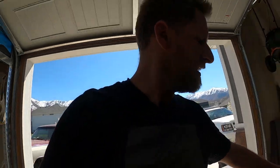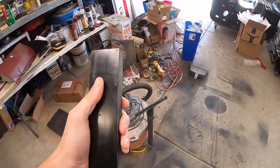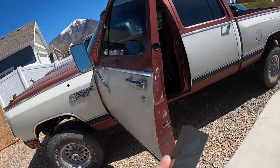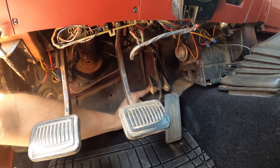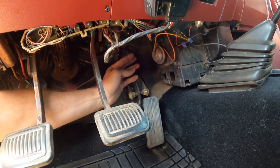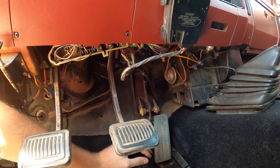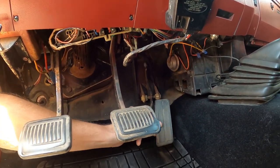In order to fix this issue, we're going to do two different things. I've got this plastic stock that I used for my body lift on the OG crew cab — you guys may remember that video. This is an inch thick, two inches wide. We're going to cut a piece off and create a spacer for the pedal, because this one is all the way against the firewall. It's held on by two bolts, so I bought some longer bolts. We're going to create a one inch spacer, and then after we get that on, we'll see what the cable situation looks like. If we need to put a spacer in the cable, I bought something that'll work for that. So let's make this spacer first, put it in and see how that affects this issue.